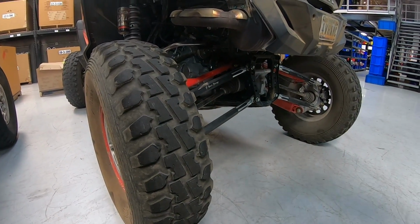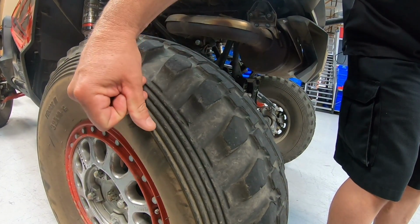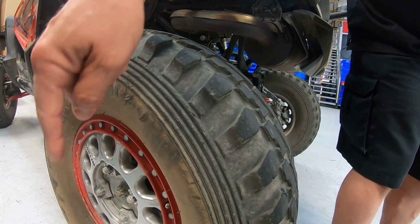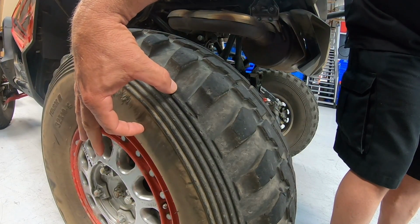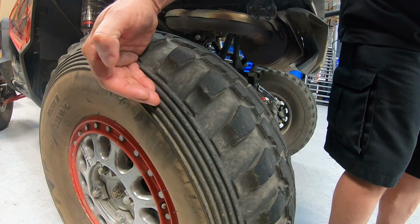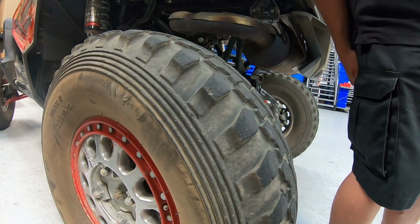Both tires have the side rib protection. You see these ribs? These do multiple things. These are rock deflectors. And if you feel these, since you've got a lot of miles on these, they're really chewed up from having rocks slide off the sidewall when you drive over them. That protects you from sidewall pinches, sidewall slices and rocks. When you get into sand, these are actually traction ribs. Sand will sit up this high and you get a lot more traction out of this. This design is specific to Tensor. It's going to be the same on the DS or on the new 33.